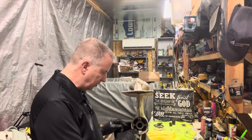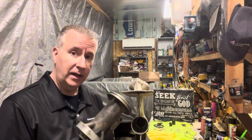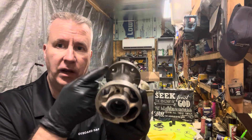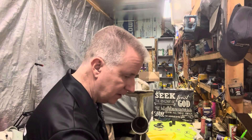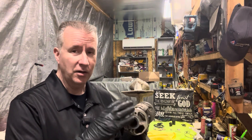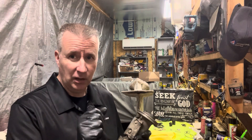I can look down from inside to see if it's seated all the way. I can also tell by the markings and the paint where it was before. You don't want to fight with this when you're putting it together, because you've got bolts that go through here to meet up with the plate. And you don't want to be fighting with it when you have the silicone on and it's drying. That's one reason I like to use Ford Motorcraft silicone — it doesn't dry too quickly and gives me a little working time. Some guys use weather stripping adhesive, and some just put grease on it. Personally, with older lower units that may have some pitting in the aluminum, I'm going to use silicone for a better chance of a longer seal.